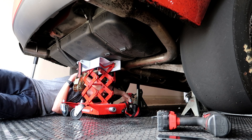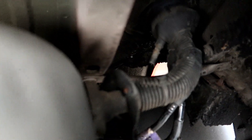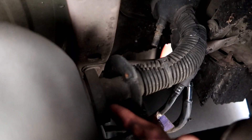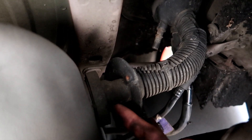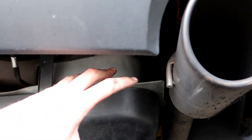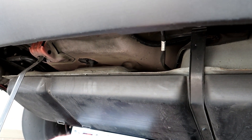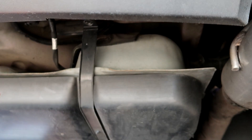It's out. I want to show you guys one thing you can have problems with on these - this grommet right here going into the gas tank. If you're too hard on it, it will leak. I always recommend if you can take these out of this grommet, you just have to be very careful. When I drop it down we're actually going to be dropping it down and pulling the whole tank this way to get it kind of out of that thing, so we've got to drop this end down and make sure this end drops down too - then we slide it out and that'll help keep pressure off that grommet and keep it from breaking.